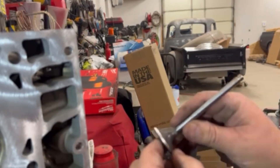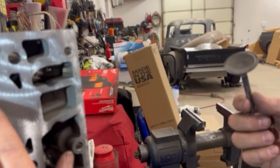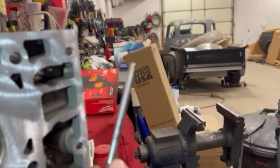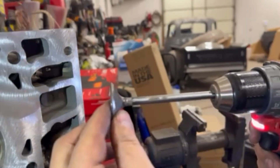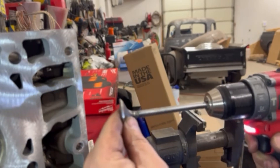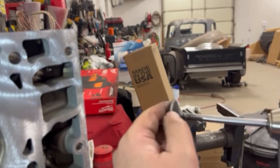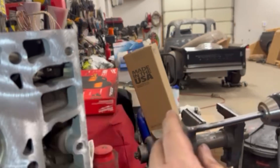What we're going to do is put some lapping compound around this. You can clean these valves up a lot more, and the chambers here on the head. I know this is going to freak some people out, but I'm going to use this drill on the lowest setting, ever so lightly — I'll put a little bit of pressure on it and rotate it real slow in and out, then rotate it back again. Once I'm done, I'll show you what it looks like — it'll get rid of 99% of those pits in the seat or on the valve.